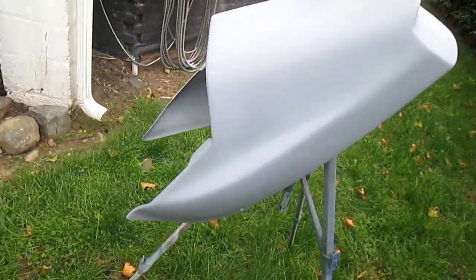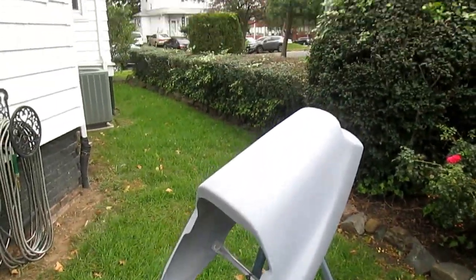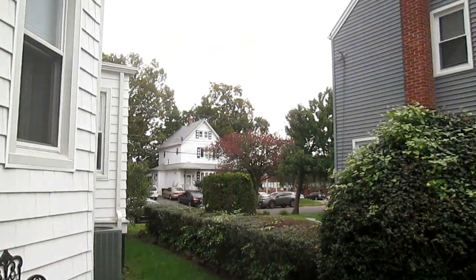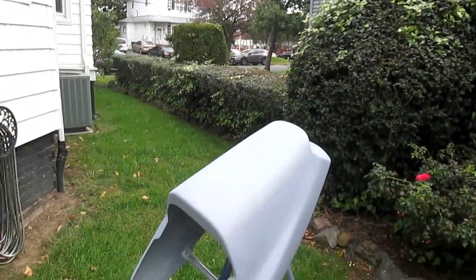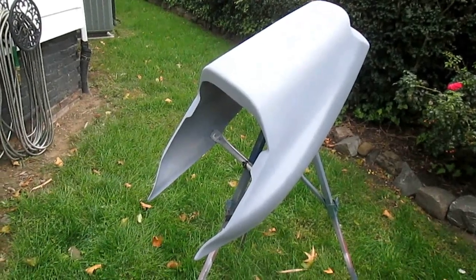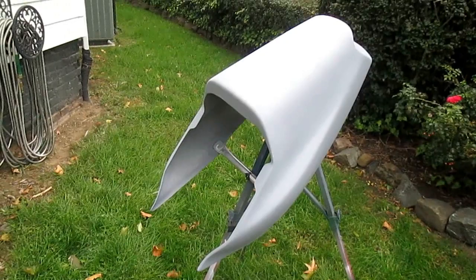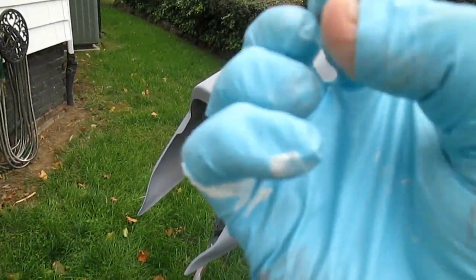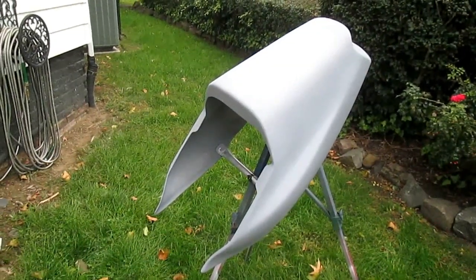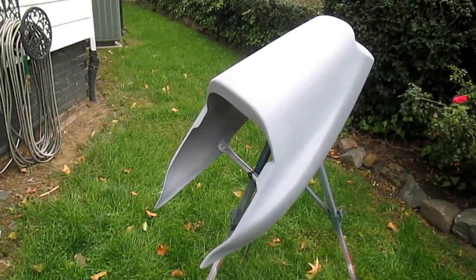Now, I'll give that a half hour or so to dry. We're coming up on 40 degrees here. It's getting cold, so cold is in our favor now, because the slow penetrating thinner in the white paint, the high penetrating, slow drying paint, should get a really good bond. We'll let this dry for half an hour, have some coffee, and come back out here ready to go.